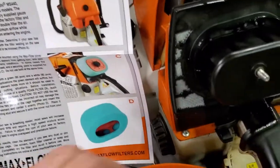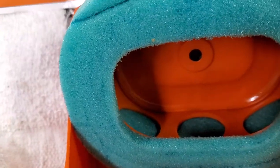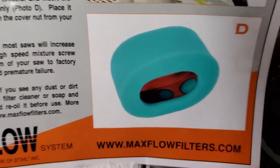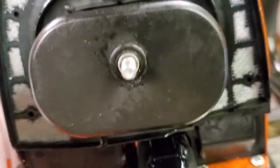There's another one of these pieces — see the one with a small hole. You got your cage right here with the holes in it, just like you see in the picture. But that other piece goes behind that cage before you put the filter on. That's got the small hole that'll fit over your stud for the base of your carburetor.